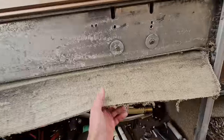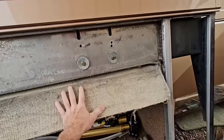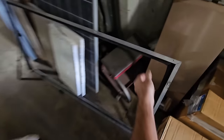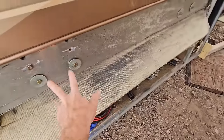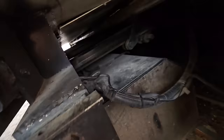Of course, Beaver, being high-quality, had it wrapped behind carpet. You have to take the compartment door off in order to get the frame of the compartment door that's riveted on off, so you can pull back the carpet and get access to the bolts. Then I had to move the filler panel so I could actually wrap my arm around to get to the mounting points for the bolts and hold the nut on the other side.